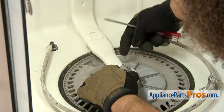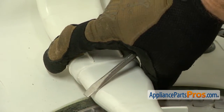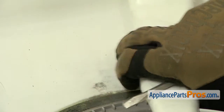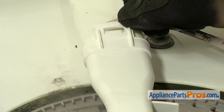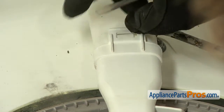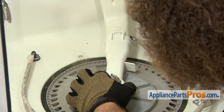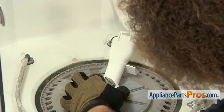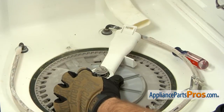Now we can go in and remove the water supply tube. We want to turn it clockwise, and then we can reach in with a small flathead screwdriver and lift up on this locking tab as we turn it so the holes will come out. Once you have them disconnected, then you can continue to turn this tube until you can lift it off the pump.